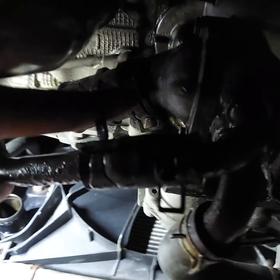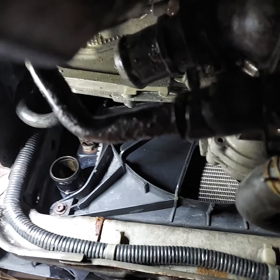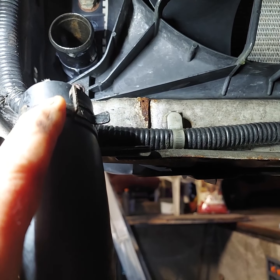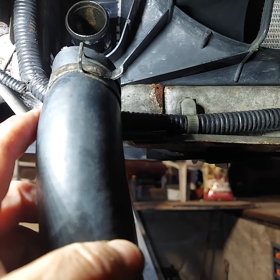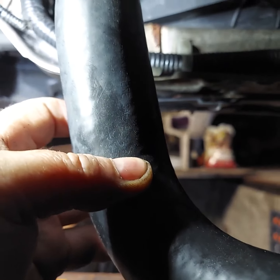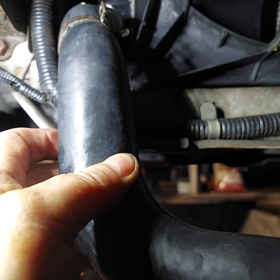I've got the outlet pipe on with the clamp in place, so when we slide the hose on we just grab the clamp, squeeze it together, and slide it into place in the center of the clamp area. I've got the clamp installed on the hose in the same clock position it was when I took it off — it doesn't matter a few degrees one way or the other. Just make sure when the hose goes on it's not in a twist causing it to kink, because if it kinks it restricts the flow and under temperature and pressure it can blow out.